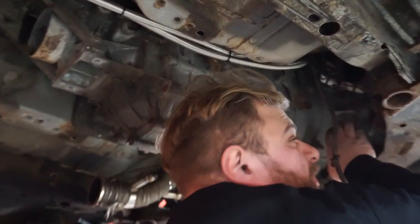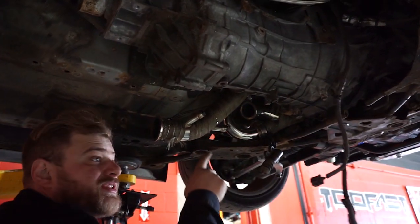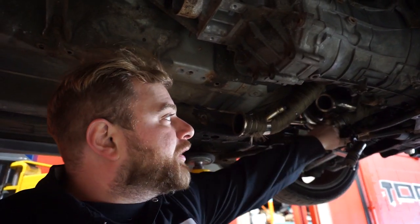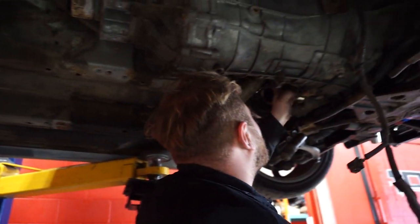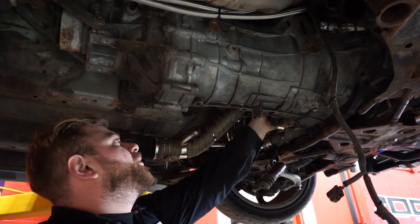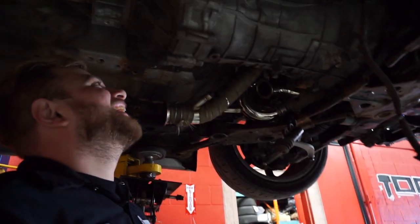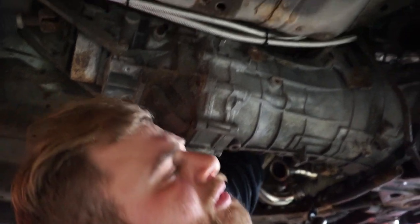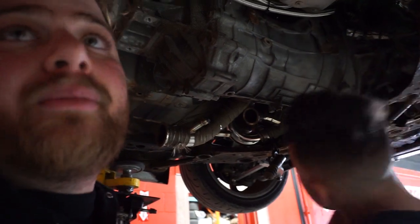Okay, so all of the bolts on this side are actually removed. Now we're gonna come on to this side. This side's a little more complicated because we have all the turbo piping and the exhaust side actually routed here, and the downpipe itself, right? But I already got one out. It's this one right here, the easiest one. There's, I believe, one or two more up top. Just feel right here. One there. Yeah, two more. And then the tranny will actually come out.